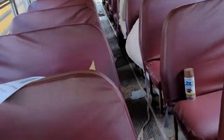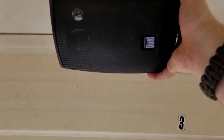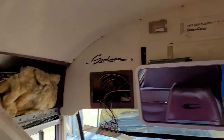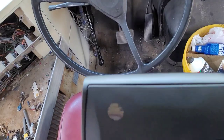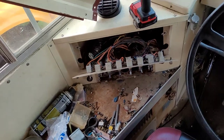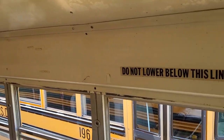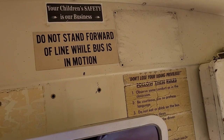Before we do the antenna, I forgot about the speakers. Here's one of the speakers — it's a decent size. I'm thinking for back here I mount one on either side, around the fourth row of seats. And then up front, mount them like that — one there and one here. The fun part is going to be routing the wire, especially from this side all the way across since I can't open this up. The back speaker wires shouldn't be too terribly bad. I want to get the speaker wire run first before I do the head unit.